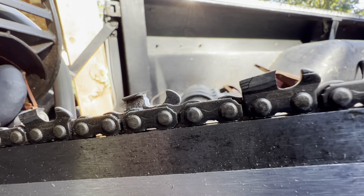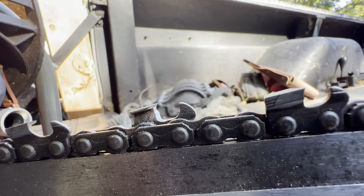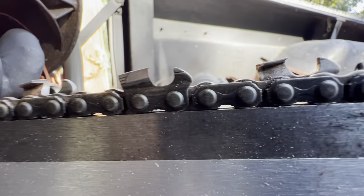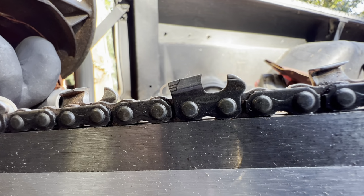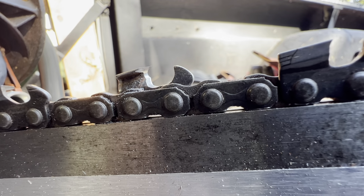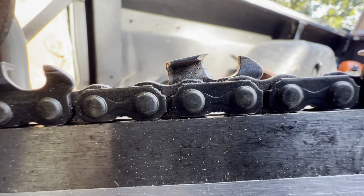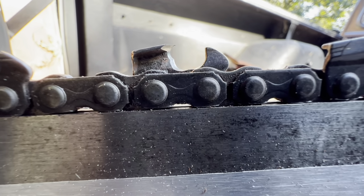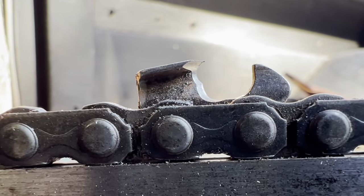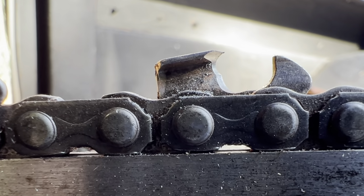Can you see that? So check out underneath the top plate. Look at how sharp that is compared to, say, that. Look at the stock tooth. Look at that. Oh my. This is the image that prompted questions from you guys about dulling fast. And you are absolutely right. You can see if you look closely. Look at that right there. You can actually see three segments. So yes, that tooth absolutely would have looked like it would have dulled fast.